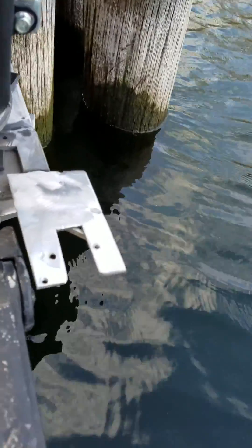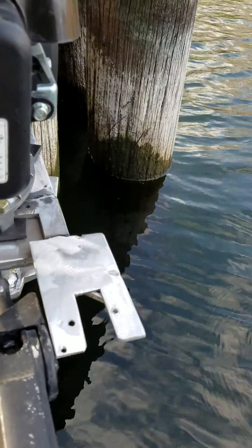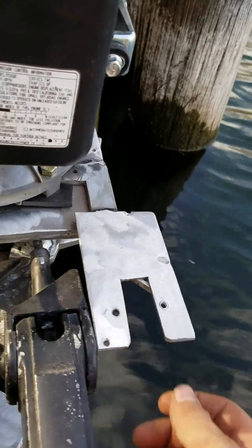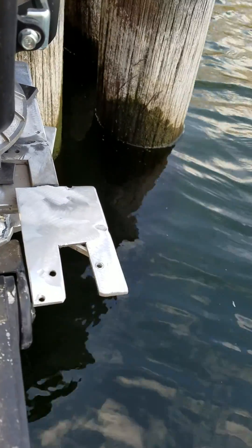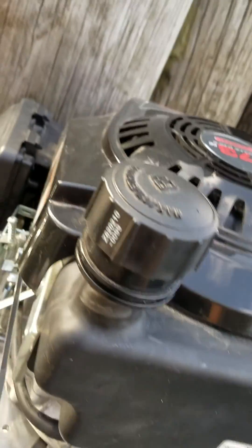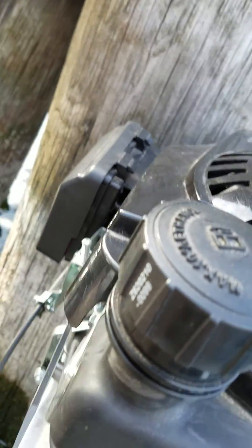This little bracket here was originally for a kill switch. I had tried a battery shutoff switch, an ignition switch, a toggle switch — every single switch I've tried, nothing has worked. I was running a direct short in the spark plug, and because all of this is welded together to the same base, it's shorting itself out. So the key has to be in the off position to run. Instead, I'm using the primer bulb as a kill switch — prime it one time, it shuts the motor off, and you fire it right back up after that.